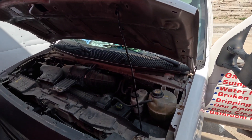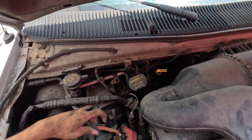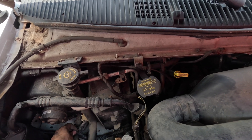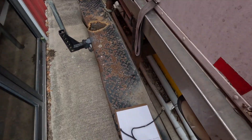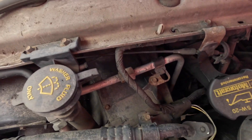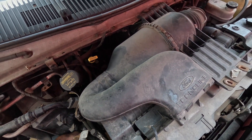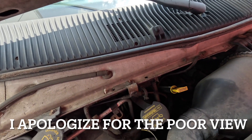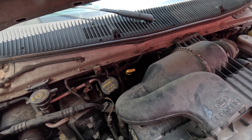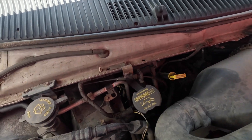What I realized is the wiring is eaten pretty bad. I saw this, but this is older. Notice the ground cable is chewed through — basically gone. We also have this wire down here which connects to this connector right down here. I have the other end of the connector inside. That is what takes the starter signal from the junction box all the way down to that connector and then down to the starter. That had very high resistance because one strand of the wire was touching it, but other than that it's eaten through.